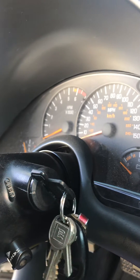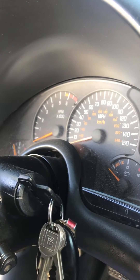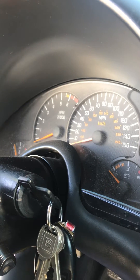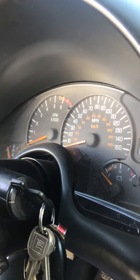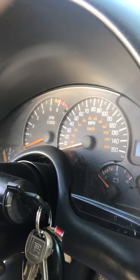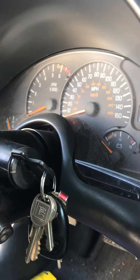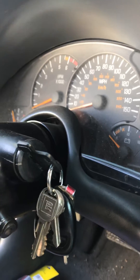What happened is I hopped in my car and it wouldn't start. I checked all the fuses and relays, checked the fuel pump, put the key in the run position, jumped the starter, and it'd just die right away. Everything was pointing towards the ignition, so I started checking out the VATS security system.